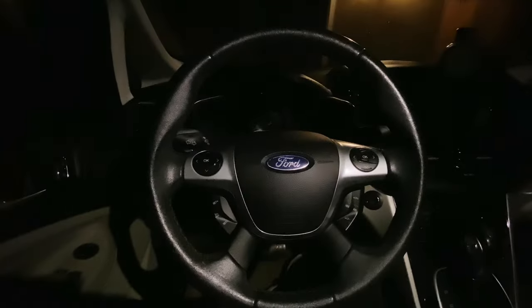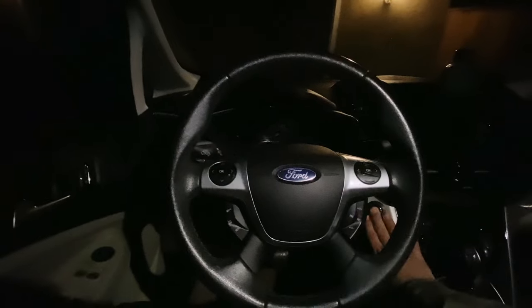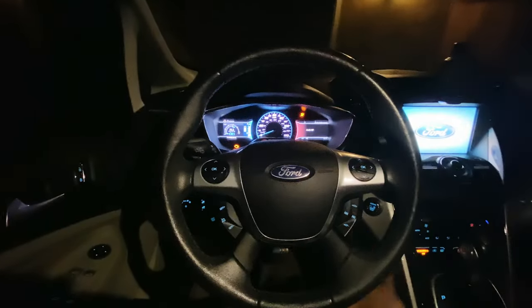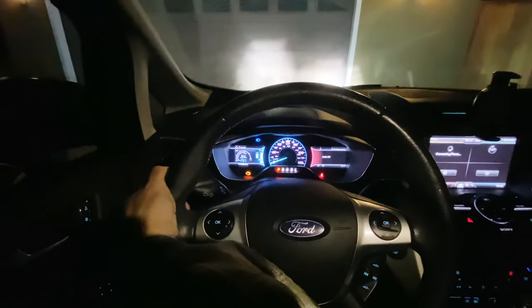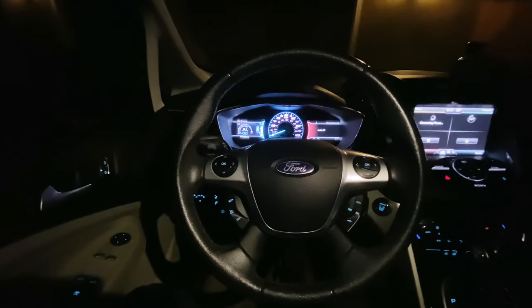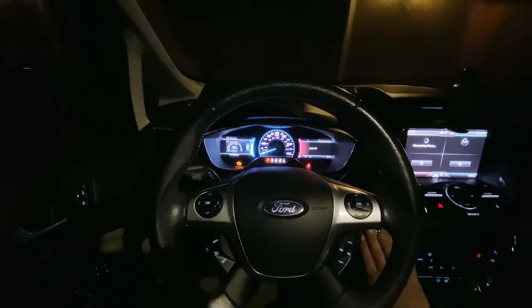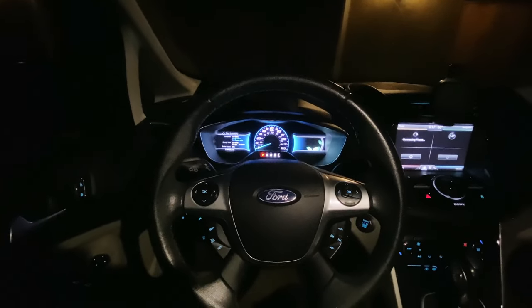There's also a manual procedure — it didn't work on my car but did work on other people's cars. To reset the battery age in the car's computer manually: turn on accessory mode — just press the button without the brake pedal — then flash the high beams five times, then press the brake three times: one, two... then shut it off. That should reset the battery age in the computer.